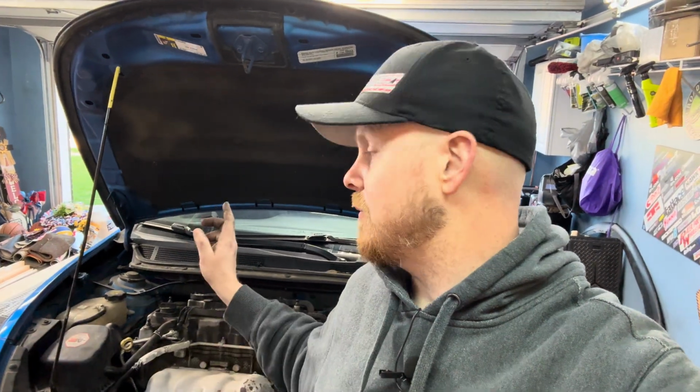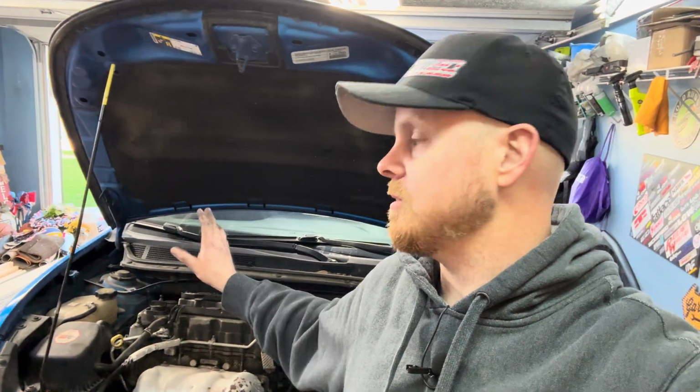Okay, now the big question is, how long are these going to last? I will say, from what I've read, if you replace one, replace the other one. You don't want one bad mount and then put a new one in. That can make the new one prematurely wear, and then you're back in there again. So best chance of these living is replacing both these uppers at the same time. So we'll see what happens. Hopefully I can just daily this thing and have no problems.